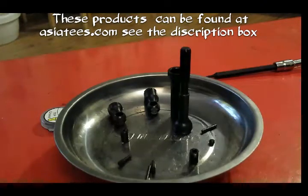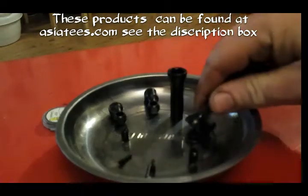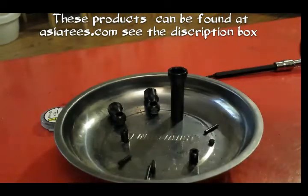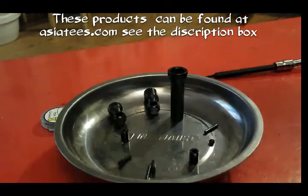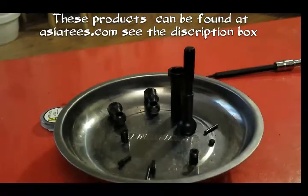If the shafts ever start to round out slightly on the holes, so if they start to wear on that hole there, all you do is go up a little bit in size on the drill bit blank, put it in, take the slop out. So they're awesome shafts, you'll never break them. So may as well get on with building them.